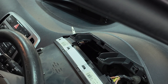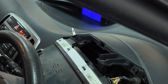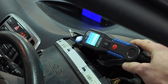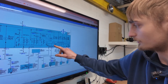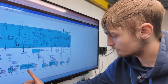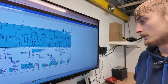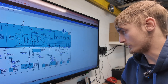Here we are at the cluster. Ignition on, sender is plugged in. So what we should have is 11 volts - and we don't, we've got earth. That means we've got a problem. So we know from the instrument cluster our signal wire is sending live to the sender through it, and we know that now this needs to have the voltage coming back up. We should have 11 volts up here and we don't - we've got ground.